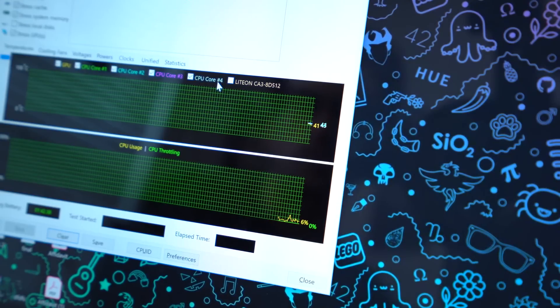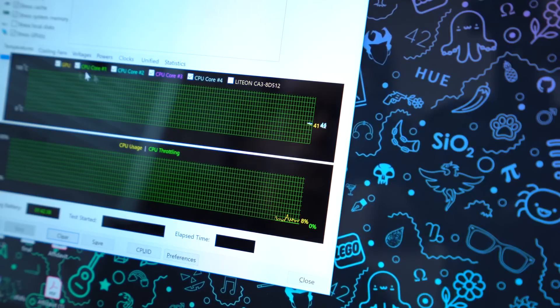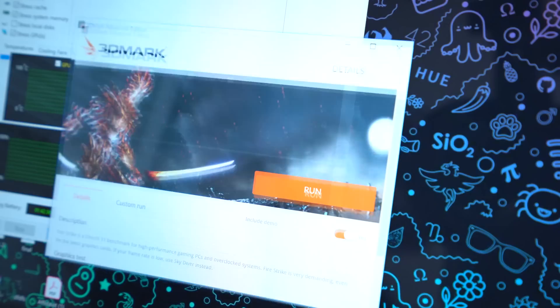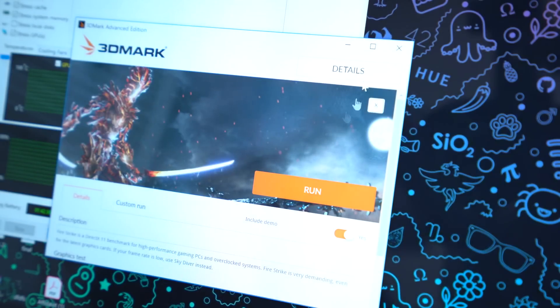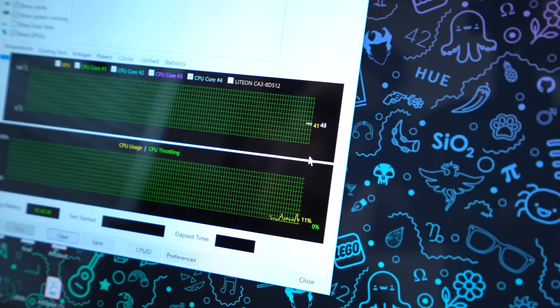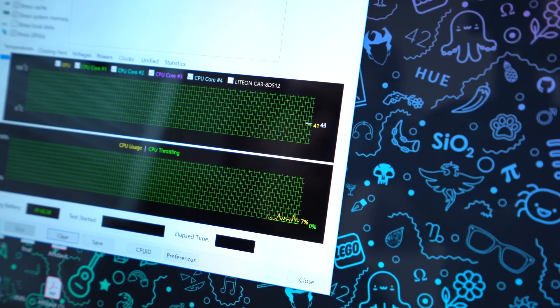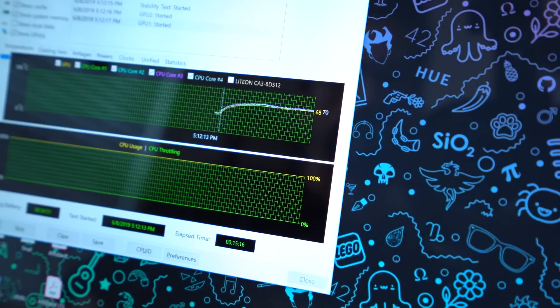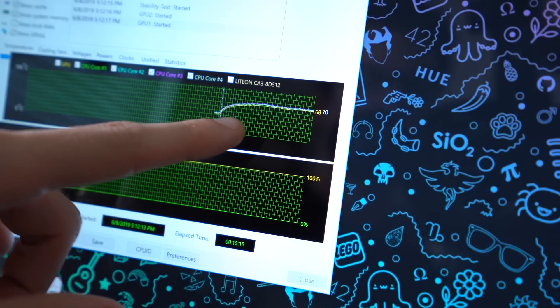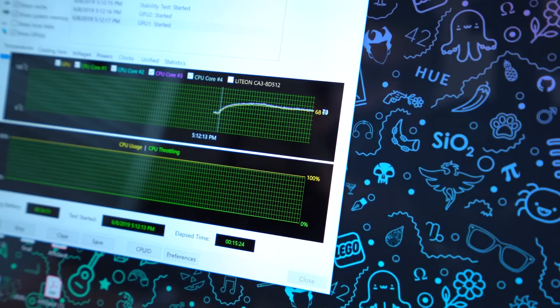We're ready to go. You can see all four CPU cores showing, plus the GPU diode — I believe that's the GPU diode; there's only one sensor with the MX150. 3DMark is open but not running, and MSI Afterburner is running in the background to keep the MX150 enabled. Going ahead and starting the stress test now. A little over 15 minutes in — I wanted to see if this trend continued. It actually got a little cooler at one point and has leveled off for the last eight or so minutes. Being an air-cooled system, once it's heat-soaked it can't dump more heat than it already is.